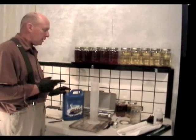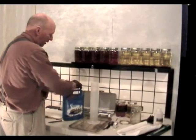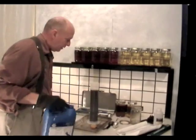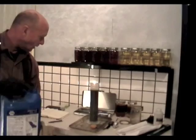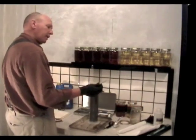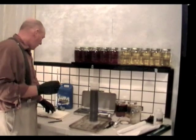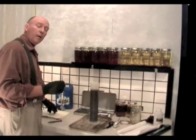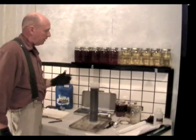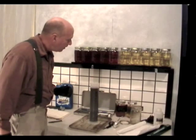What I'm going to do with the stale gasoline is measure its specific gravity and its viscosity. This is just a one gallon sample of that 18 gallons. I've nearly filled the graduated cylinder with the stale gasoline so I have plenty of room for the hydrometer. Let's try the .800 to .850 hydrometer, because diesel fuel was measured out at .843. It almost tops out, but it looks like it's going to end up being .81.